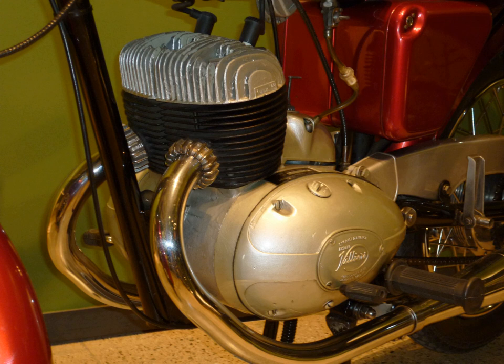In a 180-degree engine, one piston rises as the other falls. This balances the primary free force, but instead produces a rocking couple which is normally cancelled by a balance shaft. It also shares the buzzy secondary imbalance of inline fours, normally left unchecked due to lower total reciprocating mass. The 180-degree separation means cylinder 2 fires 180 degrees after cylinder 1, and cylinder 1 does not fire again for another 540 degrees. The irregular ignition pulses change the harmonic contribution of vibration transmitted into the drivetrain, frame, and chassis. Most importantly, it reintroduces the fundamental harmonic of a single cylinder, making for a more lumpy delivery.